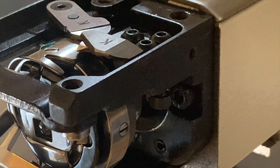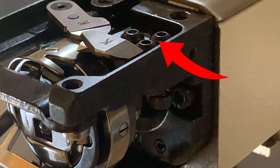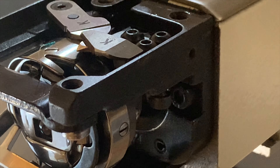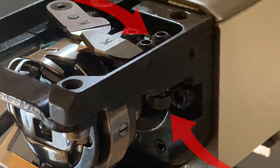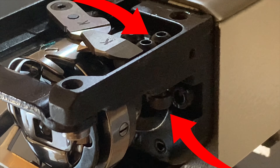The fixed knife is screwed inside the needle plate base. It is also the one that requires to be leveled, or properly adjusted, in order to create the perfect friction between the two blades. Maneuvering all three screws, you will be able to level the fixed knife to achieve the perfect friction between the two blades.